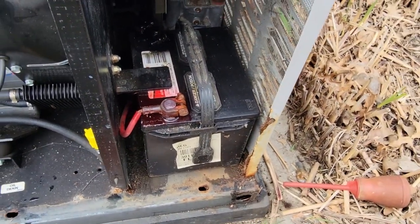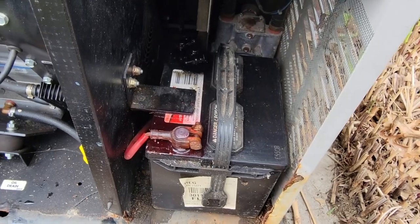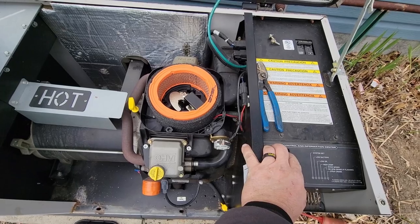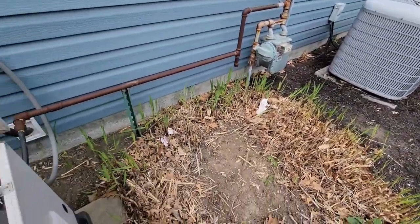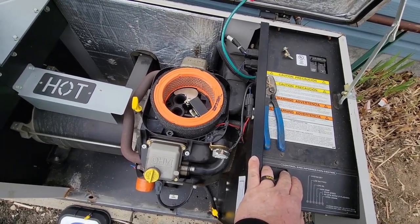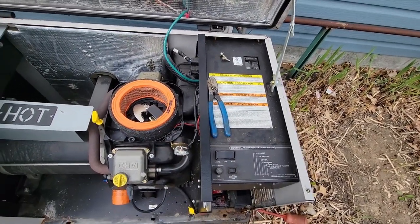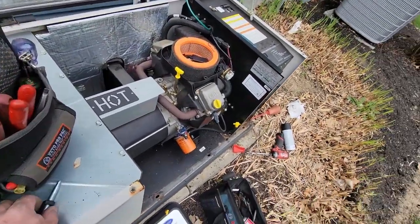Nobody sees it in there. I like to make it look as good as possible, but at this point I'm not going to make a special run just for a battery terminal. Let's go ahead and kick this thing on, see if the choke opens and closes like it's supposed to. Put it in manual - they do have power, so we're just making sure it works. Now, if I stuck my two fingers in there and it sucked that fuel through nice and fast, it probably worked just fine, but we're going to go ahead and check the gas pressure anyway.